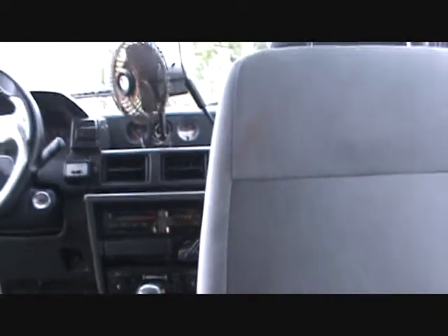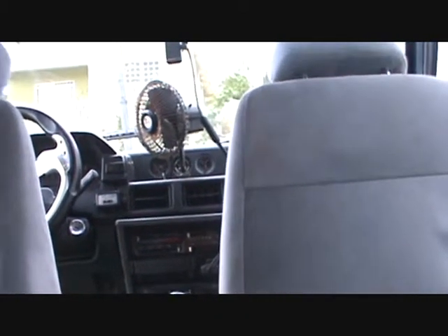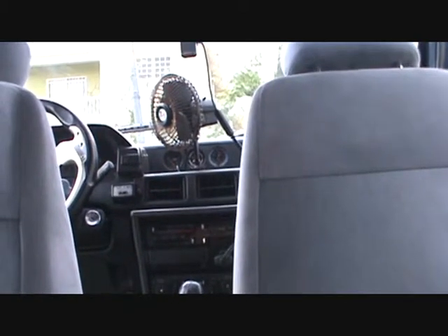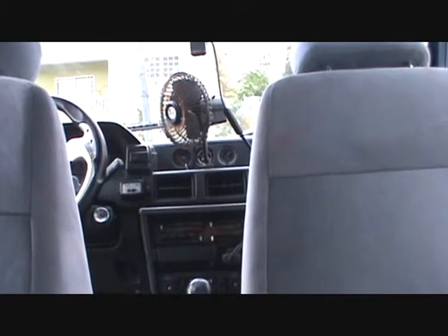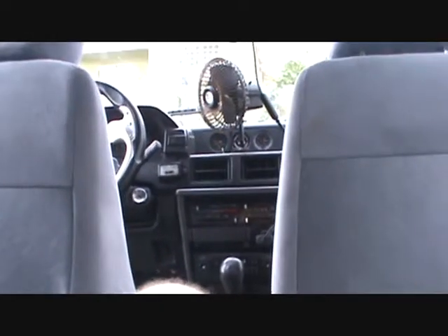So there you have it guys — it's just my first two speakers in, out of eight. I'm seriously considering thinking I've bought too many speakers, because these two sound great. But once I get the amplifier and the new head unit — I've already got my monoblock amplifier, which I'm still disputing where I'm going to put — I'm probably going to stick them back over in here, between the roll bar. I wanted to put them on the inside of the panels, but after reading a little bit more about these amplifiers, I'm going to have to give them a lot of air.